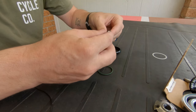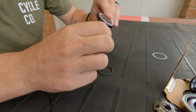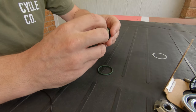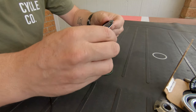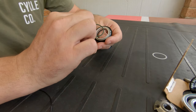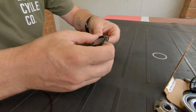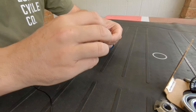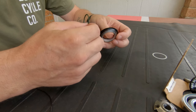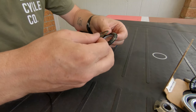I made a bit of a mistake initially when installing the bearing ring and the split ring — I installed them into the grip lock cap and then put the O ring into the space in between. The issue with this is when you put it in that way, one it's wrong and it's not going to work, and two there's not enough room for the O ring. So when you try and squeeze that over top of your steerer tube it just doesn't have enough room to get over it, and I suspect people that have made that mistake have potentially ruined their O ring. So you want to be very careful to make sure this is installed in the right way, and the instructions aren't very descriptive.